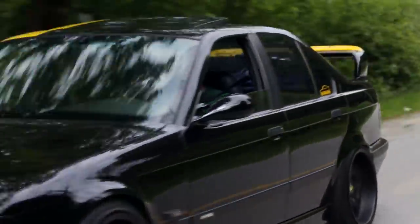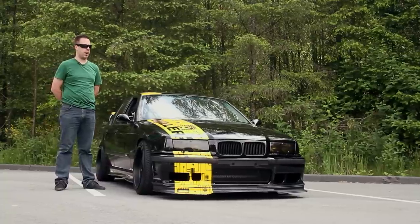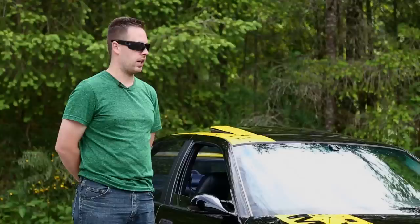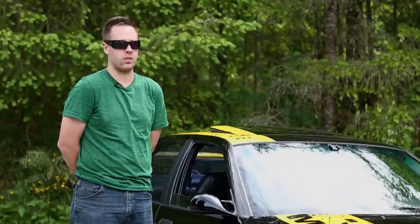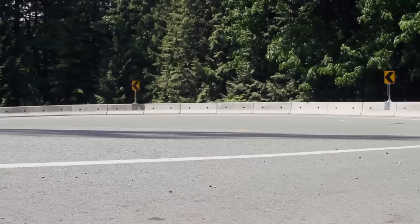They have a problem with tearing out the rear subframes. The later E36 has remedied that from the factory. But as long as there's no rust and the subframe is okay, reinforce it right away and go have fun. They're cheap and easy to own.